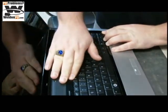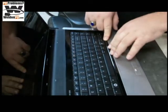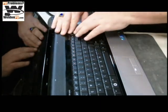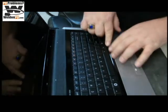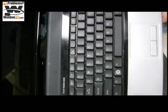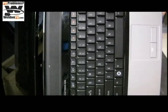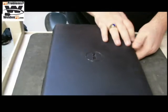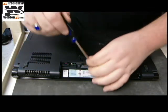When you do this, you just listen for that popping sound. Make sure you go around two or three times so you've got everything. Once you're finished, before you put that last screw back in, go around the keyboard and make sure it's even with the bezel and the bezel is even with the rest of the case — just to make sure you're giving the client a complete job. Then we've got one screw to reinstall.